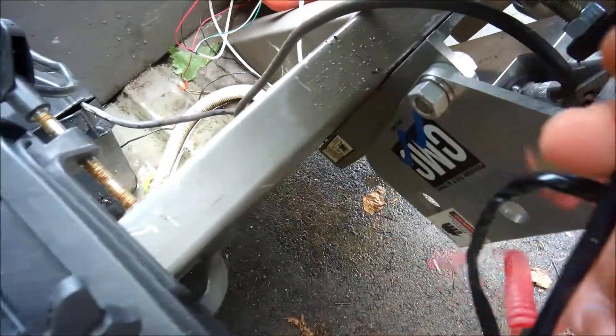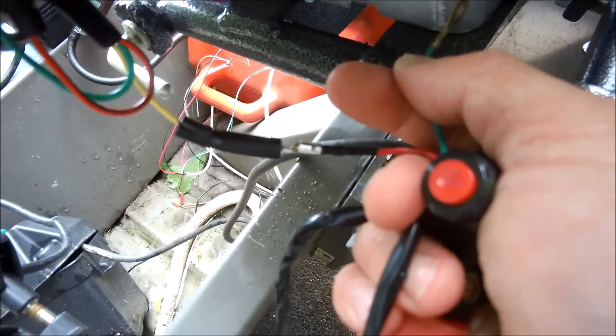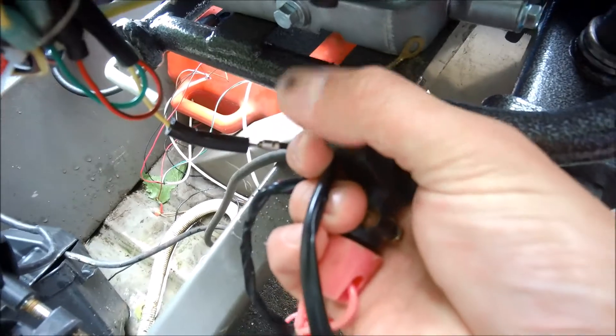This is all I have. I took my kill switch — here's my leads. I tied the red, which has a bullet connector already on it, and touch the ground. Then you push the button — that's all there is. Long story short, you're going to have two wires from your kill switch. Take one wire and tie it to the yellow wire coming from your harness for the key switch. Then take your other lead and tie it to the engine block — just make a good ground. When you push that button it's just going to go to ground. Hope that helps!